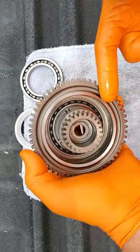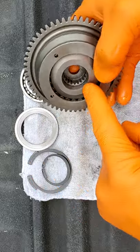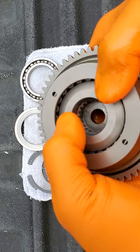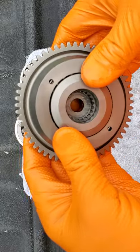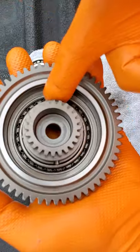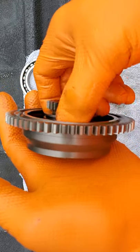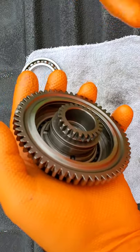So what I've got broken down now is three pieces. I'm calling it inner race or drive — this comes directly off your crankshaft. Your crankshaft input is right here; that's the bolt torqued to 59 foot-pounds you see in the instructions. You've got input drive to the splines here. Back here you can see the sprags kind of hidden underneath. It's a series of 24 sprags in here — I've counted them. They look like a dog bone. It's a one-way clutch, a drive unit. As your crankshaft turns — clockwise if you're sitting on the ski — your inner is going to turn and force the outer to come around.